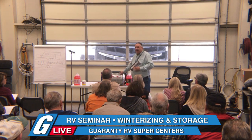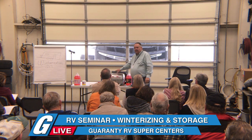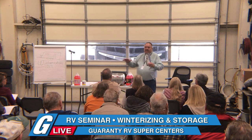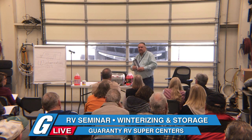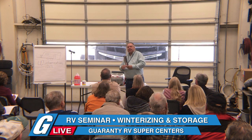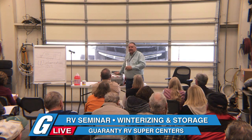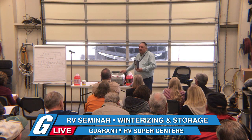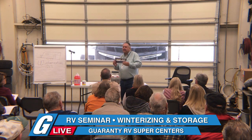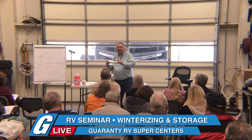They do not require an anode because this anode is a sacrificial material, because you have electrolysis in your system. This absorbs the electrolysis, and this is eroded, where Atwood thinks they'll let their tank be eaten up, and in 10 years you put a new tank in. So if you have a Suburban, you will have to remove this for winterizing, and this is how they look when they're brand new.